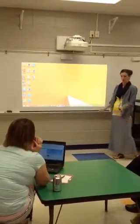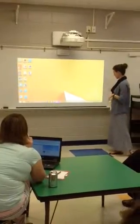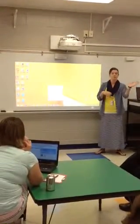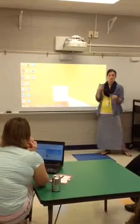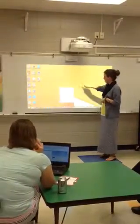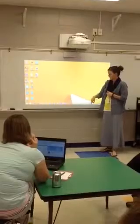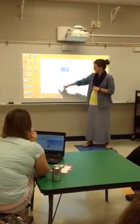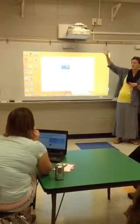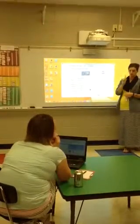It does take a little bit of time for technicians to come out — they have to manually use tools to calibrate it, and they're kind of backed up right now with all the installations. Once you have your display on, you're going to hold your finger down — this is just the first time or every time you switch to a different classroom. It's setting your screen resolution so that your touch is one-to-one. Click on screen resolution, then go to resolution and make sure it's as high as it can go. Not all computers work on the highest resolution, but start at the highest and come down a notch if the calibration isn't right.